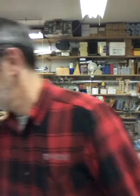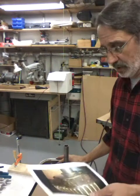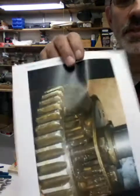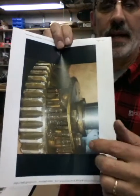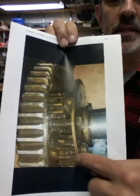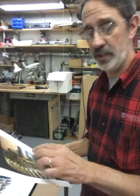First thing he says is he bought this Snapper — it looks new. There's a little paint mist on the boots, so it looks like they might have touched something up. He noticed one thing when he took the differential apart: when he tore his differential apart, this is what he found. It's the inside with the large gear and your four planetary gears, but the way they put it back together, they put this bolt through the gear like it's supposed to be — except they missed the gear. It's just floating in there.